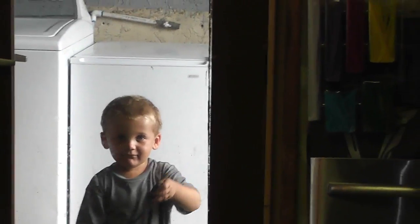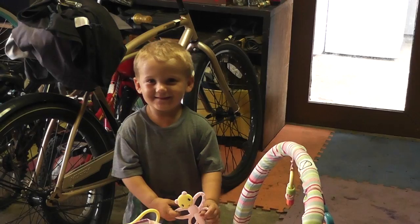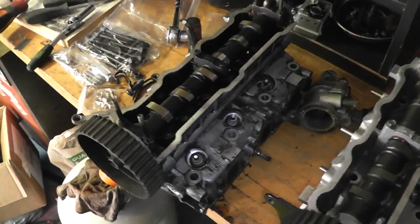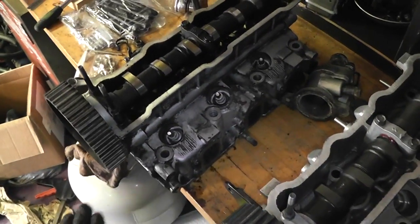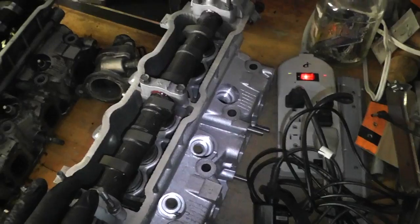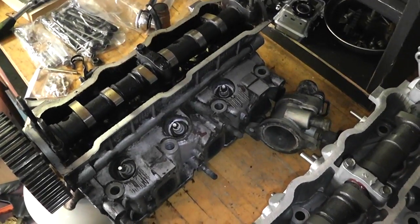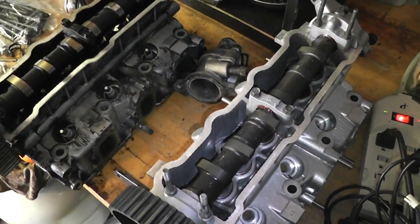We now have a helper. If you're doing this without a helper, good luck to you. Here's the old one — if you were not replacing the head you would just take this to a machine shop, they regrind the bottom and that's that, replace valves or whatever you need. In this case I've got stainless steel swirl-polished valves and new things in here that make it fancy. Basically you're at the point I'm at — intimidating, but let's see what happens. I have new seals.